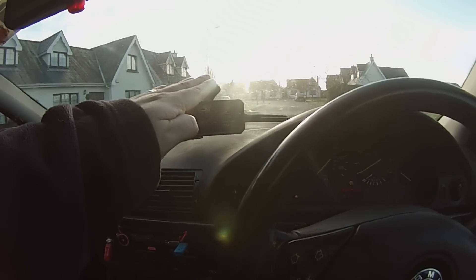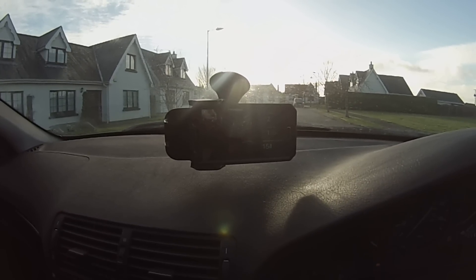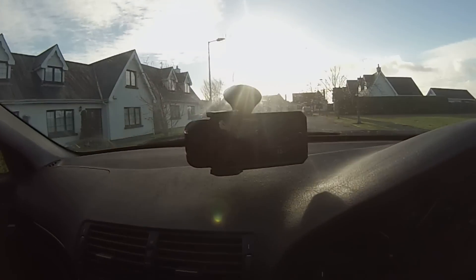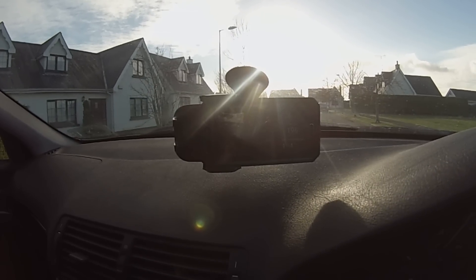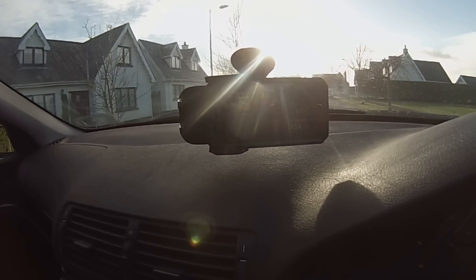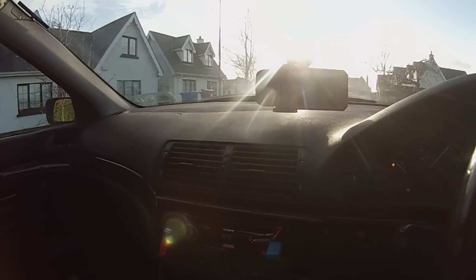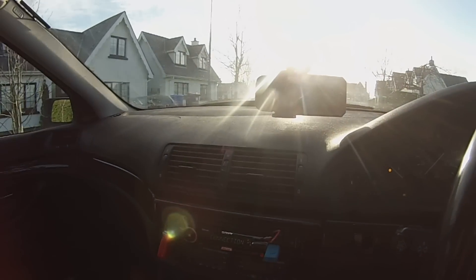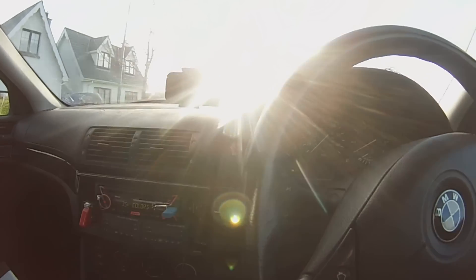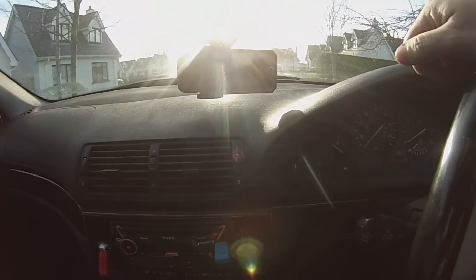The second thing is: if we release the handbrake, there's a tiny bit of a slope in the direction of travel, and if we just apply the throttle we get about three or four amps and the car actually starts to move. We're actually moving with just three to four amps — six to eight hundred watts of electric power going into the inverter. This was completely impossible before; it was 30 or 40 amps before the vehicle would get moving at all.